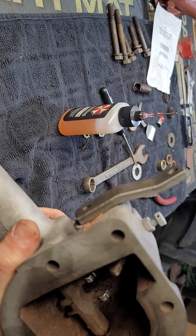This thing went through 70 years of abuse and it shows, giving that little bit of wobble. For this tractor now being used mainly for hayrides, plowing some snow, and shows — very minor use compared to what it used to be — it's gonna take a long time to wear back out again. And if it does get to the point where there's a lot of play again, I'll just pop it off, drill it out, and push in a brass sleeve. No big deal.